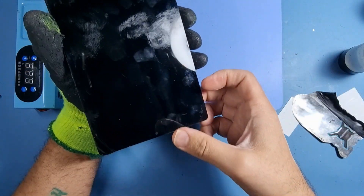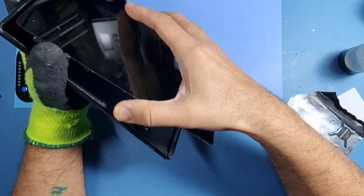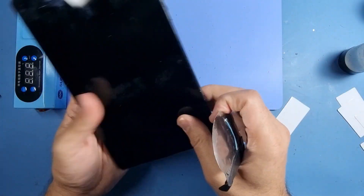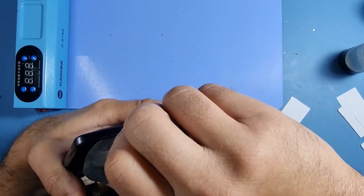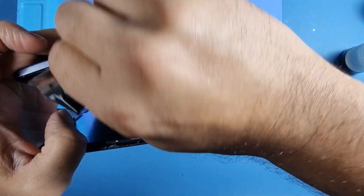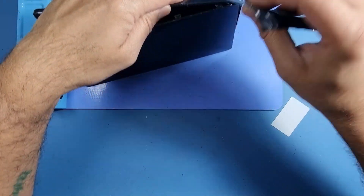I don't want to bend it — I'm sure there's another way of doing this. So the flex goes in between underneath this frame here. This part has to just pop out. There are a few screws behind — so this only comes out from the sides. Let's see if we can get in here. So that's how you open this device. Let's get into this frame between the metal and the plastic — that will come out. Be careful where the power button and the volume buttons are, because that could easily damage something behind there, so we'll avoid that area.